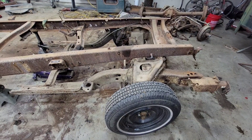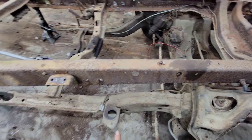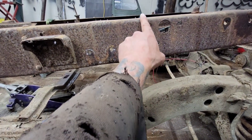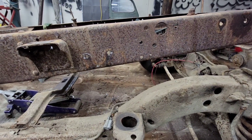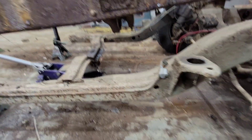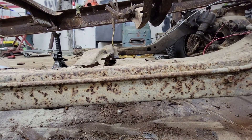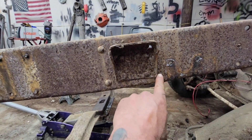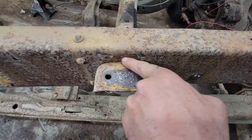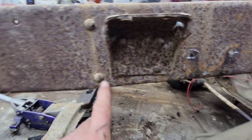The first thing I'm going to start with is hacking off the frame somewhere over here — you can kind of see where it's lined up right now. I'm going to hack that off right along here, just to get it out of my way and have a little more room and thinking space. The frame is about two and three quarter inches wide, and it's going to run right through here. I'm going to clean off all this metal, weld in here, and then cut off right here.